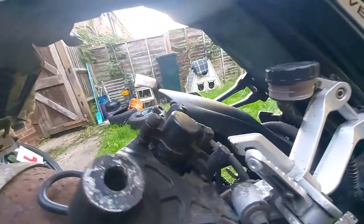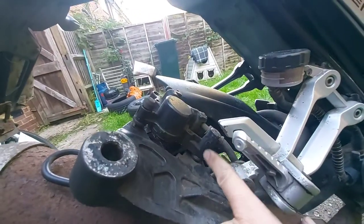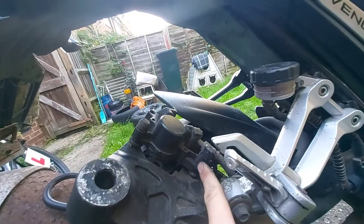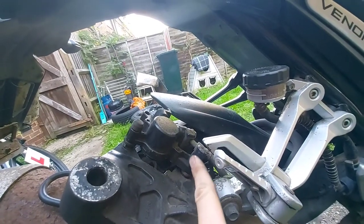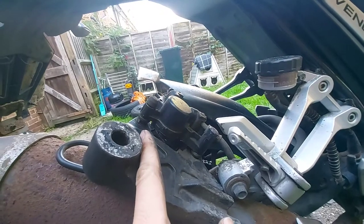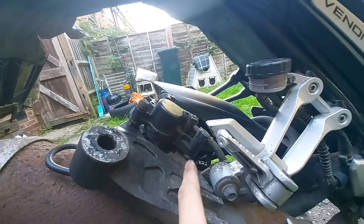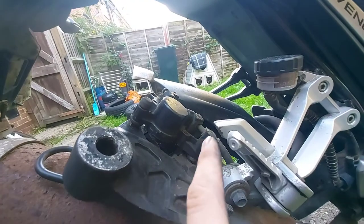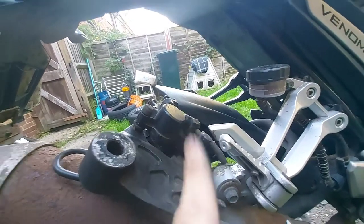So while I'm at it, I had a look at the back brake. I pulled the caliper off, and one of the sliders is completely solid — the other has a bit of movement but that one's stuck. That's why the brakes are seized on. I'm going to try undoing that one to get to the hex on it and wiggle it with a bit of rotational movement, then clean them up and throw it back together.